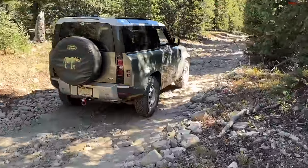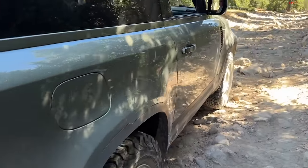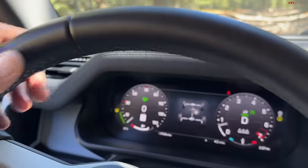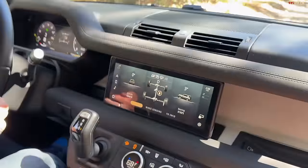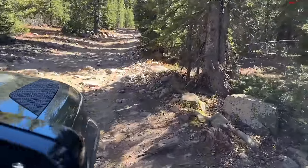Oh, that is so much better! We were at 48 PSI — why was the tire pressure so high? We're not a heavy-duty truck. But this is so much nicer — it's settled down. Onwards and onwards. We lost some ground clearance but gained so much more comfort. This feels so much better, especially right now because this trail is so rocky. We could have gone lower, but you run the risk of popping the bead off the tire. We'll also need to air up after we're done.